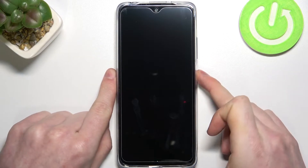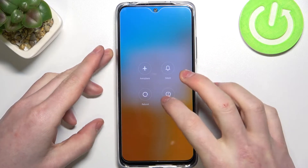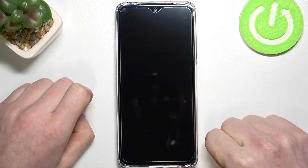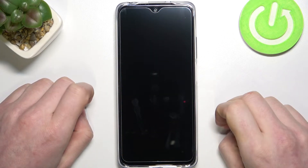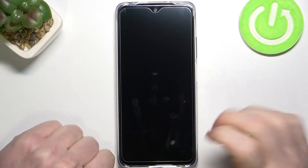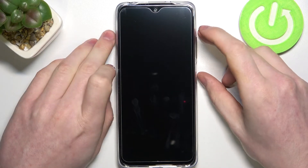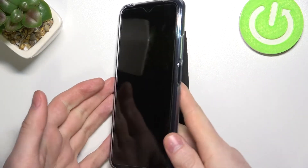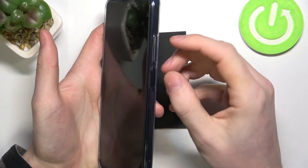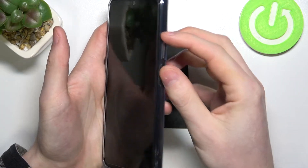To do this, we'll need to turn off the phone — power off. Just wait about three to five seconds until it's actually powered off like that. And now to perform the hard reset, we'll need to press this button — the lock button and the volume up button. So let's try that.